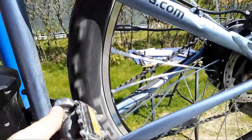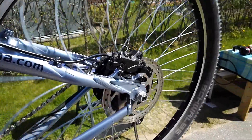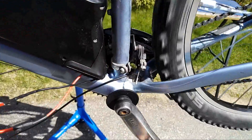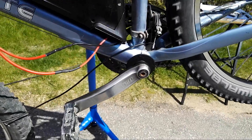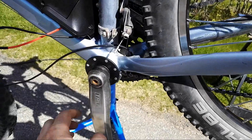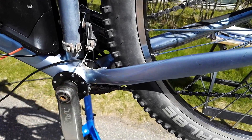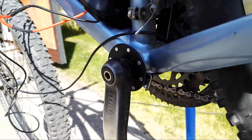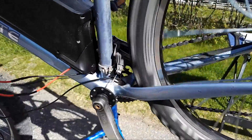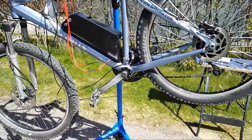Other than that, it's spinning pretty nicely and sounds good — just annoying that the rear disc brake rotor is rubbing because it's quite badly out of true. The next thing is to flip that magnetic disc and see if we can get it running when spinning the crank the correct way. The disc is flipped, the magnets now face outwards. Testing it — yes, the PAS sensor works fine either way, but you do have to pay attention to the direction of rotation. We have a working system now.